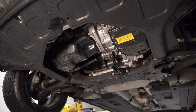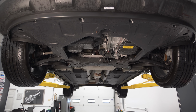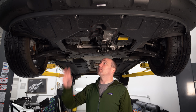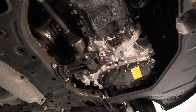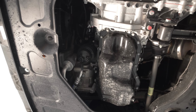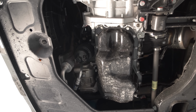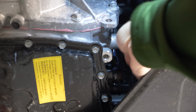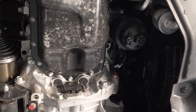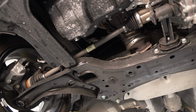In the case of the Venue, this is definitely a lot more affordable, and you see it on the underbody. Little things like this. There's clearly space to put a cover over this underbody panel, which they remove. And some of it could be cost savings, which isn't likely. More of this is about the fact that you can get to every single thing under here. You can get to the starter. You can get to the coolant lines that run to the CVT from the radiator. You can get to your oil filter, your oil drain plug. Everything is accessible with literally no effort.